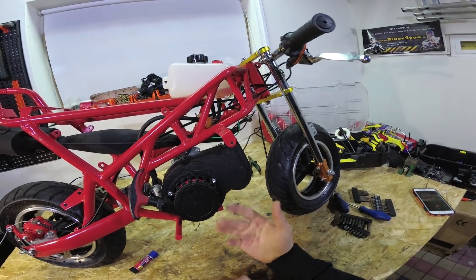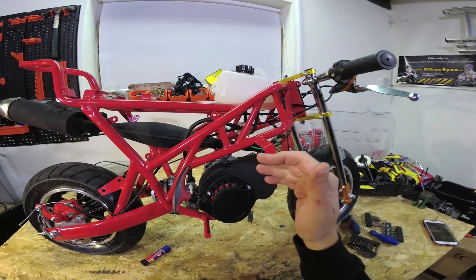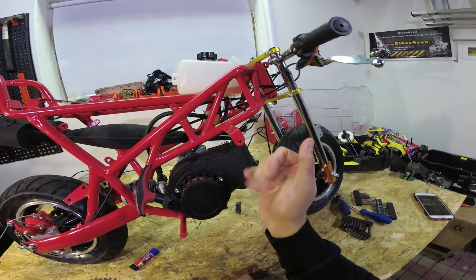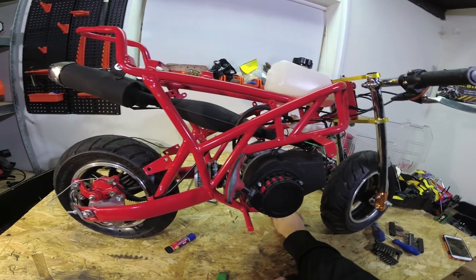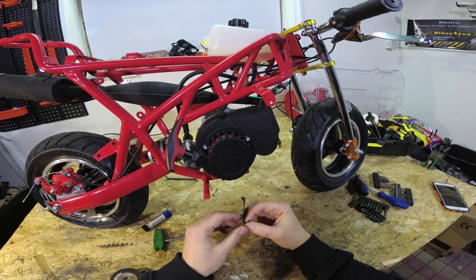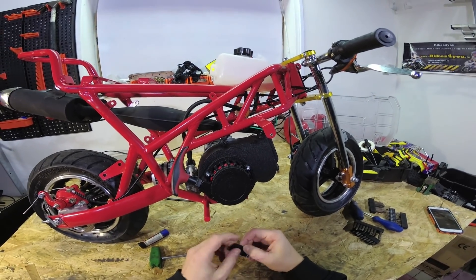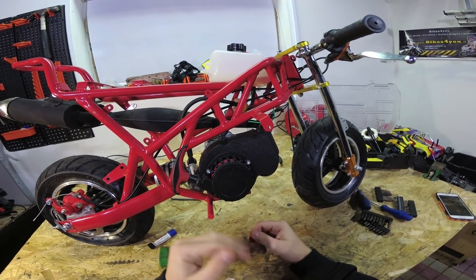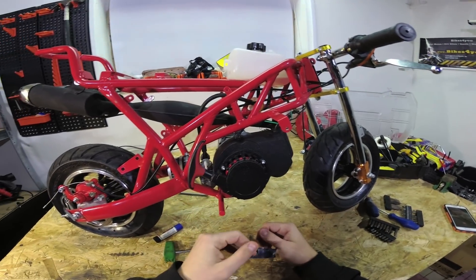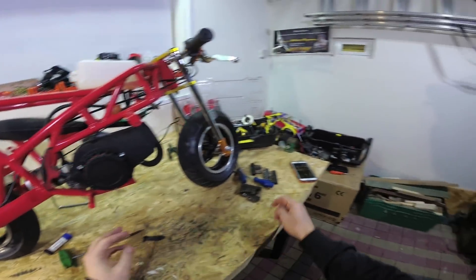As you can see, replacing the coil is very easy. If you are worried about making the proper space between the coil and the flywheel, you can use that method with the tape - make sure to put two layers of tape and it works great. I hope this video helps. If you like my channel and my videos, please subscribe. Thanks a million, see you!